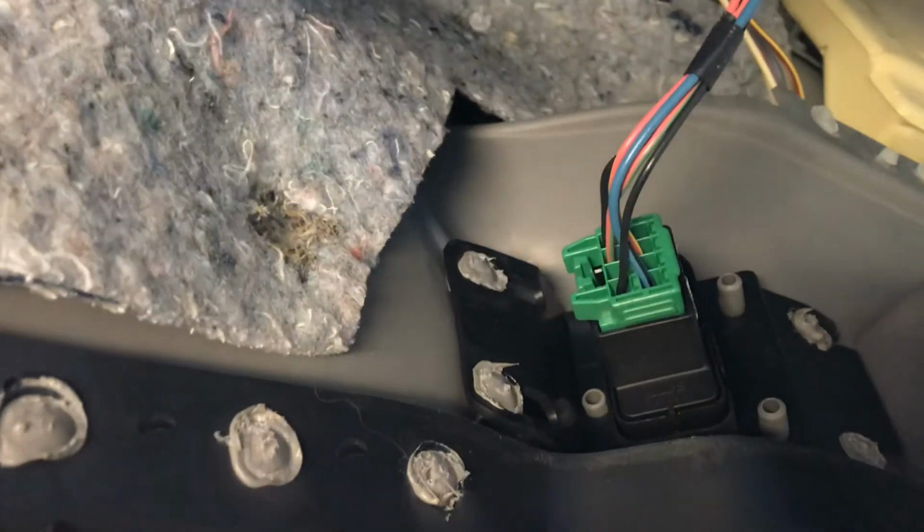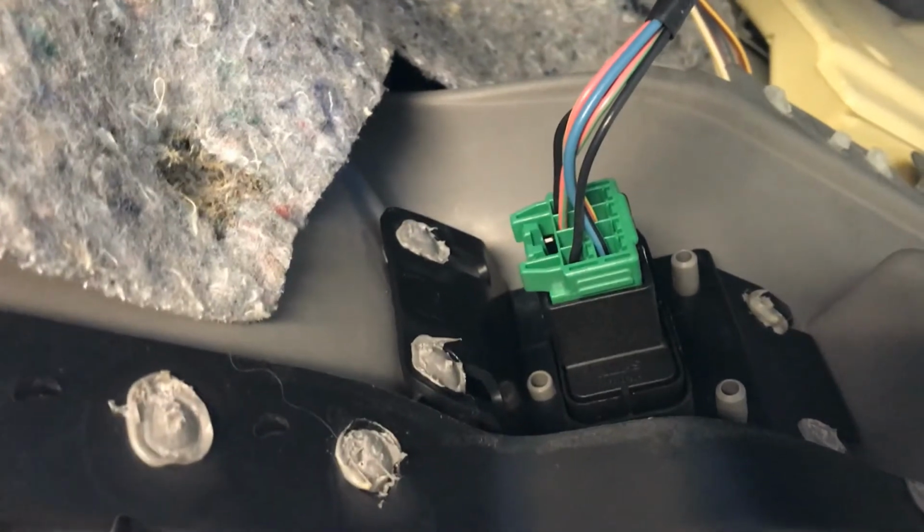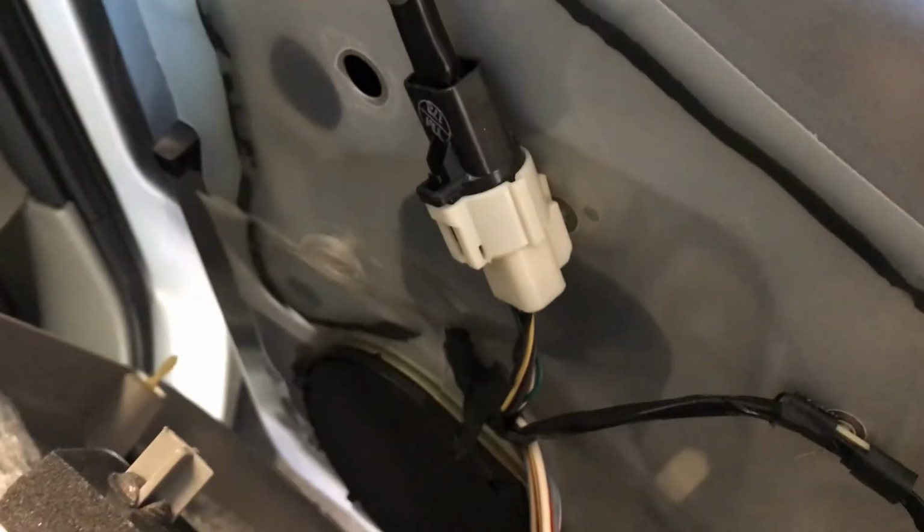And there's the little center action there, and then there's clips on the side, clips at the top, clips there. And when you put it back on, make sure you thread this back through and then the handle back through. To take the door panel off, the reason you do is these clips: one links to the power locks, the other one's to the power windows. And then of course to the power window mirror that we're going to be replacing.